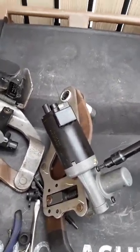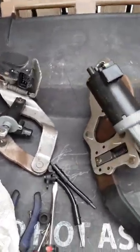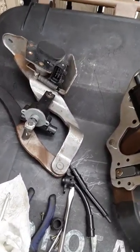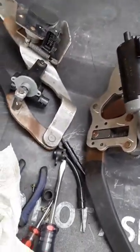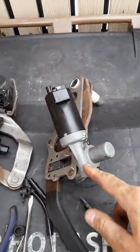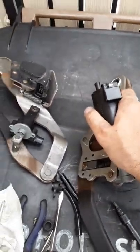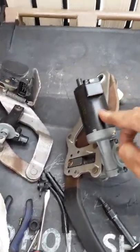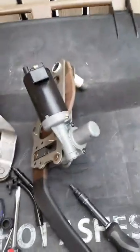This comes in a set with a plate. To replace the whole plate and everything, you've got to take the whole entire dash out — literally, the whole dash out. So check the motor, check that gear. If your pedals aren't moving back and forth, but you're hearing the solenoids and you can put your hand on the motor, hit the button on the door and feel it vibrate, then you know it's the stupid plastic gear in here. Frustrating. It's just the worm gear on both of these.